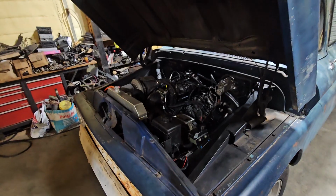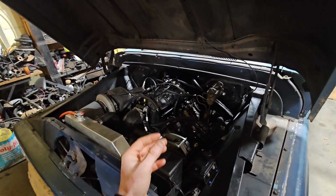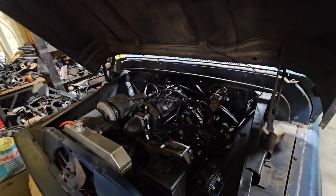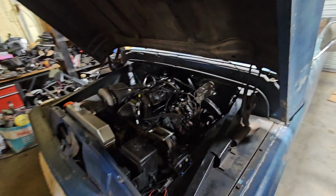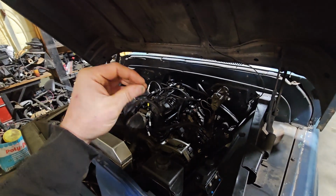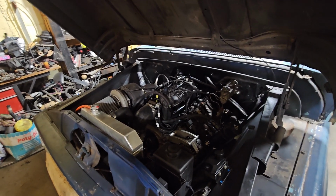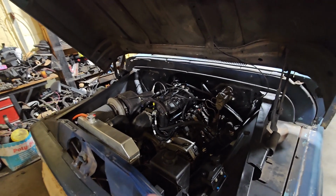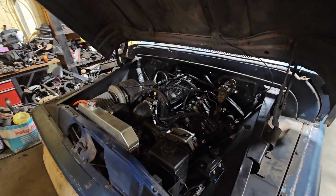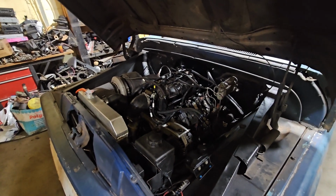The other thing is, if I did the dual fuel and had another fuel system that was basically just sitting there with E85 in it, the inherent nature of E85 is to gel up and congeal, and it just wreaks havoc on the fuel system. It sits behind the injectors, clogs up the screens in them, and it can be very problematic and very nasty if it's not constantly run through. I think Lucas makes an additive that you can run, and I would run that when I had mine as well. But E85 is kind of some nasty stuff.